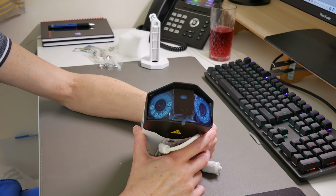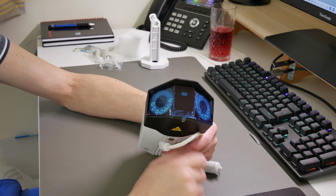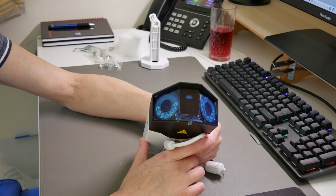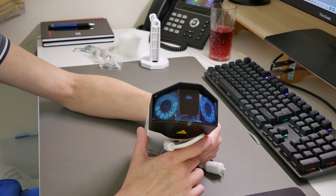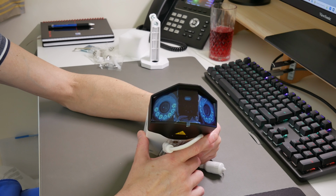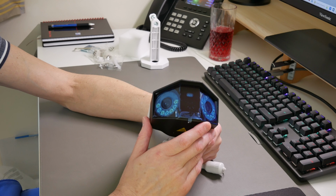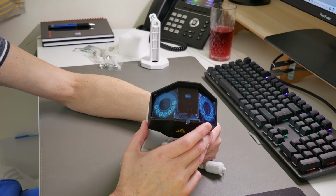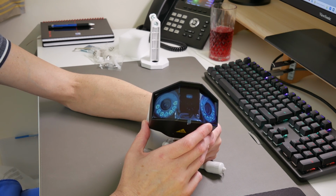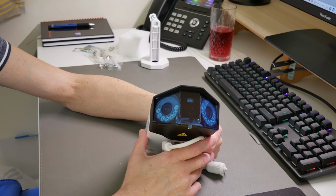The colour night vision is with the spotlights, and there's 8 spotlights on each lens, and that's with 5 watts at 6500K 560 lumens. The mainstream frame rate is between 4 frames per second and up to 20 frames per second, which is the default of 20 frames per second. And also the sub video stream can be 4 frames per second, again up to 20 frames per second, and again the default is 20 frames per second.